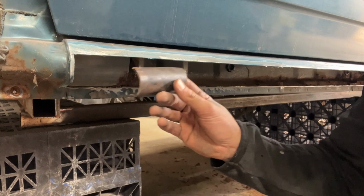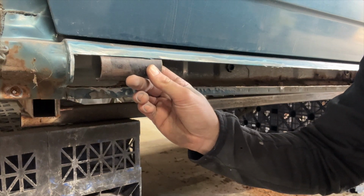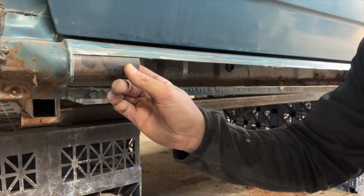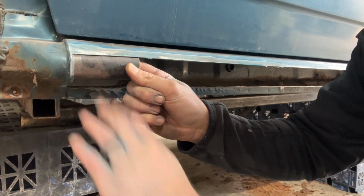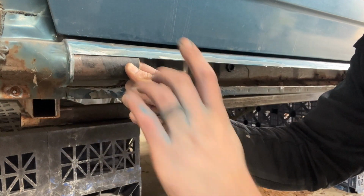Idea being, when I've got my tube laid in, I'll profile the front edge out, and when it gets to the front, it will sit in just behind that lip. Once welded and flushed, that will look like all one piece. Again, like a completely standard Daihatsu sill, but much, much stronger.